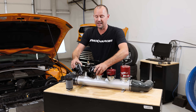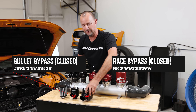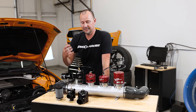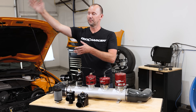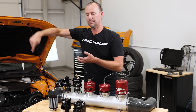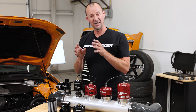Here are two other bypass valves that ProCharger makes — this is a bullet bypass valve and this is a race valve in the recirculating configuration. These don't really have a place to be used anymore. The only reason you'd use these is if you had a draw-through mass air meter, where a factory computer is measuring the air way before the supercharger, and you'd have to account for that air by bypassing it — you would not be able to blow it off. That's kind of rare, so we're not going to talk about it anymore.